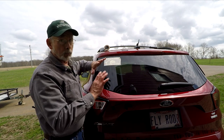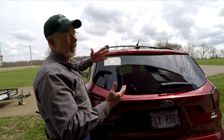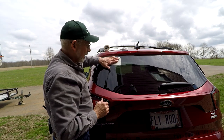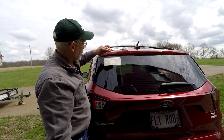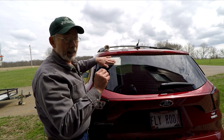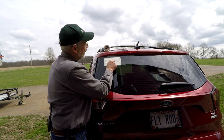If you do all of this — the most important part is cleaning the window. If you clean the window properly, you really don't have to wait to pull the application tape off of your decal while it's on the window. It may help just to wait a couple of minutes. The other tip I can give you besides the clean window is to apply this stuff in 60-plus degree weather. We've got the sun coming down and it's already warmed up the decal. Any possible bubbles that get under your decals — those little pin-size bubbles are going to go away over time. If you keep the sun beating down on it, they're just little gas bubbles and that gas will dissipate and it'll end up laying flat, unless they're really bad. Then you could use a straight pin, tap the bubble, and rub it out with your finger.